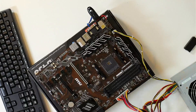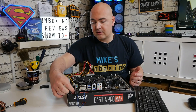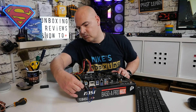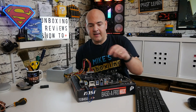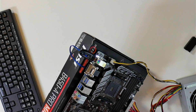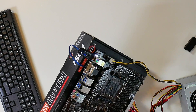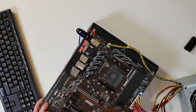We're pretty much ready. All we need to do now is plug in our power supply and apply power. Everything's connected up. Now we just briefly press the button to initialize the actual process. Hopefully you'll be able to see the LED when it comes on. You'll get the light on the top of the board saying CPU, and you can also see the flashing LED. That is the board reading the USB.